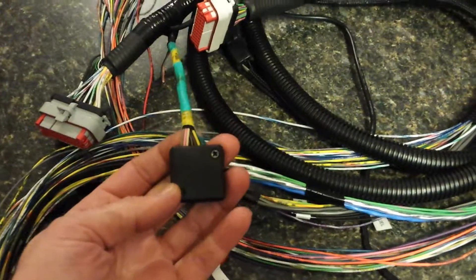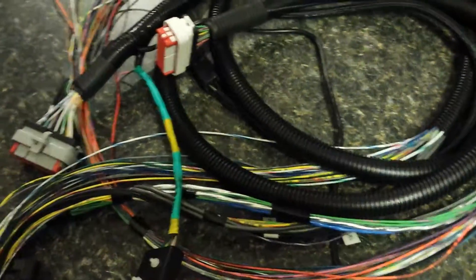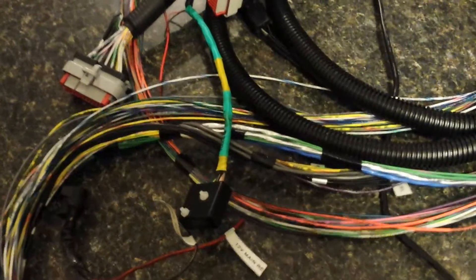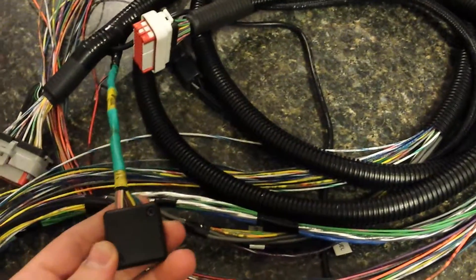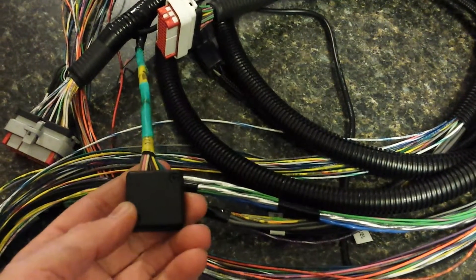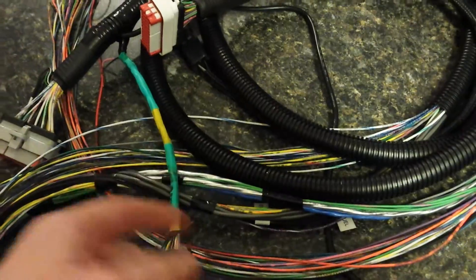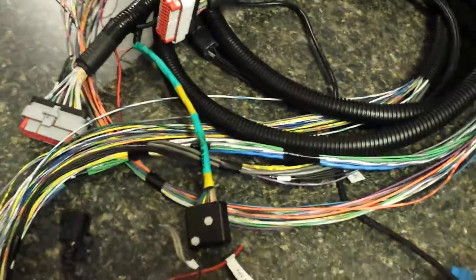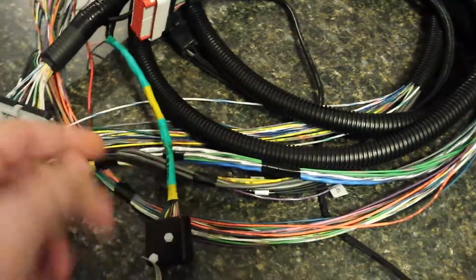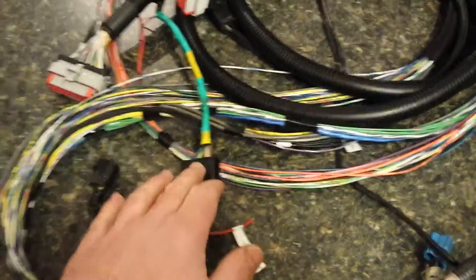Since it's the Subaru style, I have two Hall effect sensors and two variable reluctance sensors. This is a little converter that takes the VR signal, conditions it, cleans it up, and converts it into something like a Hall effect powered sensor signal. I just soldered it together and used some shrink wrap — it'll eventually get mounted somewhere, but it's a little board you have to solder all the wires to, so it's kind of challenging.